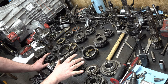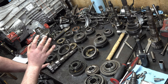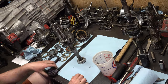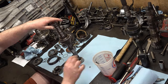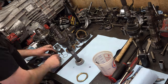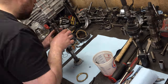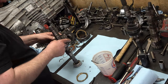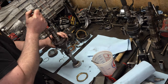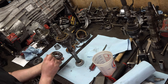Next thing I need to do is clean all the parts I'm going to use and get everything else off the table. Putting the input shaft together is pretty easy — you just have to be careful when you're pressing things together because gravity is going to want to pull it apart, so press it in the correct orientation so gravity is holding everything together. This whole transmission has to be one of the easiest transmissions to service; I really enjoy working on it. There's just a couple of snap ring grooves and those Torx bolts for the mid plate that are a little bit annoying, but otherwise it's quite simple.